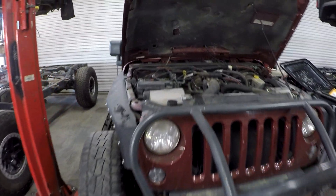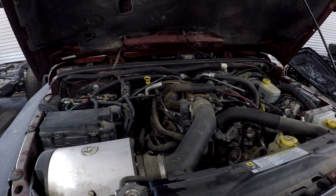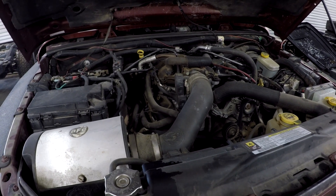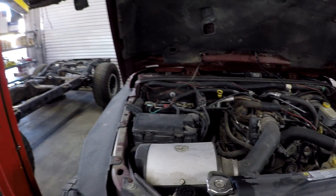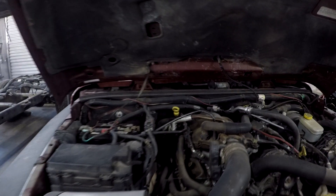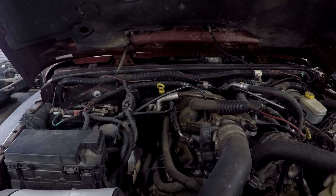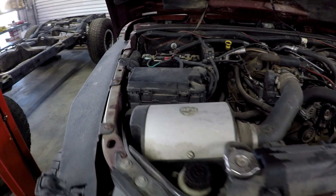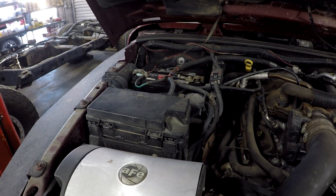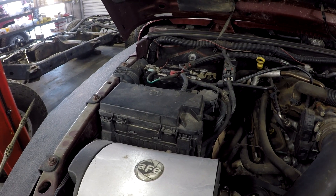This Jeep's getting ready to be torn down. I apologize — we're right outside of Nellis and I think the Thunderbirds are out practicing. I think we can all agree that this 3.8 engine was kind of a lemon in the JK. You look at this EGR — exhaust gas recirculation — it's back there, it's a pain. It's older technology that really should have gone away a while ago. Most Gen 4 and 5 engines don't have EGR valves — they use cam phasing to essentially replace it. This is their purge valve and they ran a really primitive EVAP system in these early JKs. They didn't have a fuel tank pressure sensor or as sophisticated monitoring as the GM systems have.